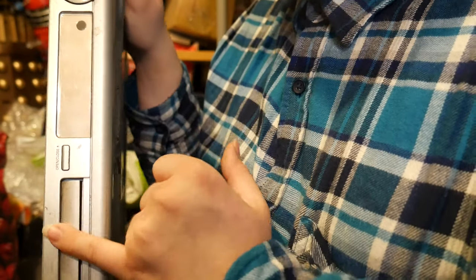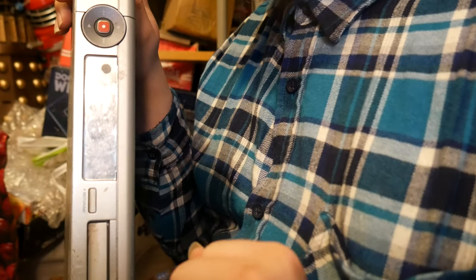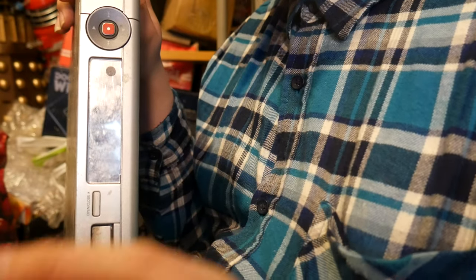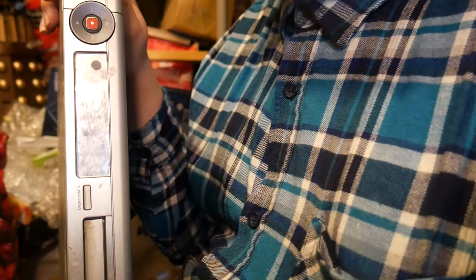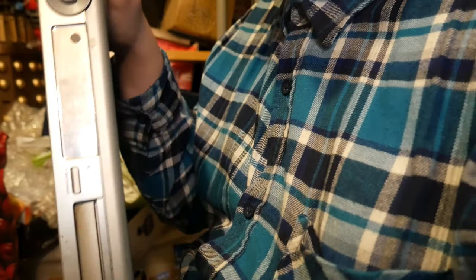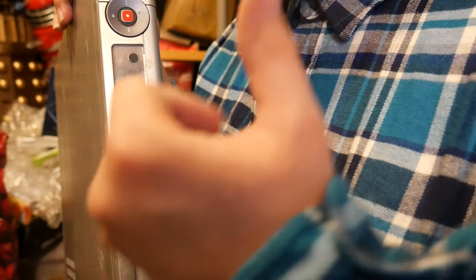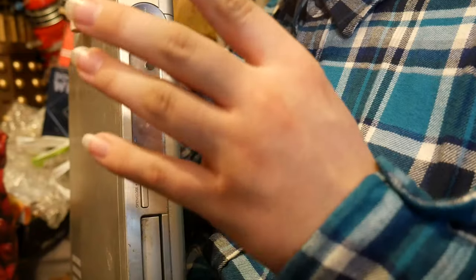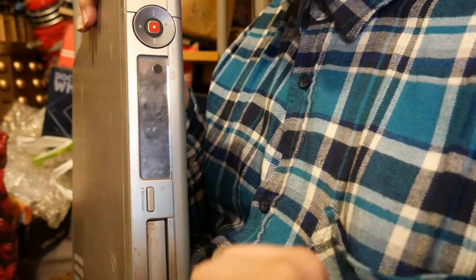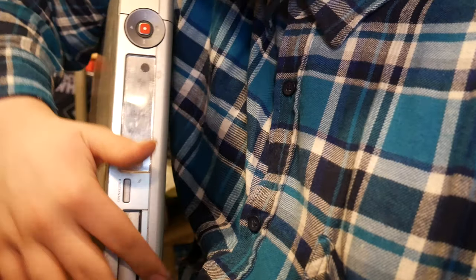Well, sort of. You see, to get the most out of the discs, you could also have a quality selector, and I always put the quality selector at the bottom. To those who know me, that may be a shock and horror, but again, it's to do with the discs. If I had the quality set to its absolute highest, a standard 4.7GB disc would only record for an hour. At standard quality, it would be 2 hours, which, okay, fine. Then for long play, it would extend that to 4 hours, getting better. But then for super long play, you get 6 hours of record time out of a disc.